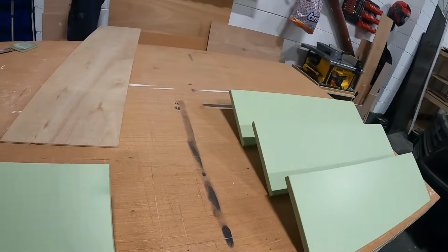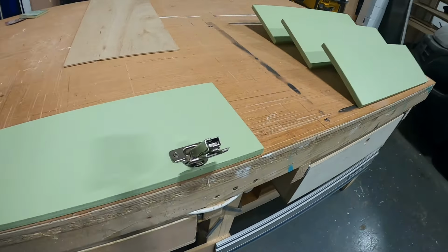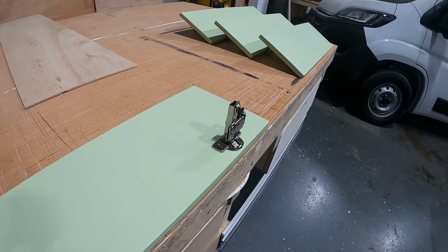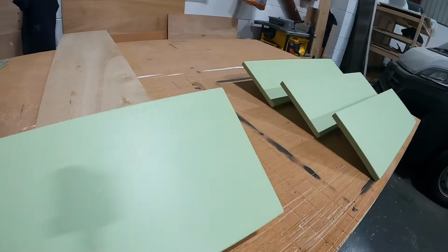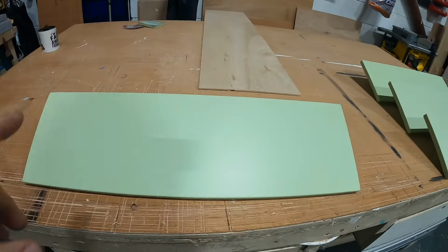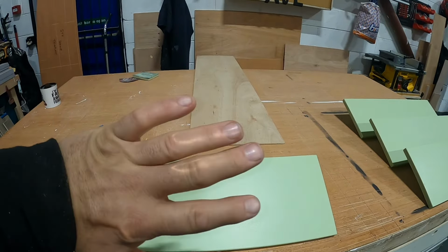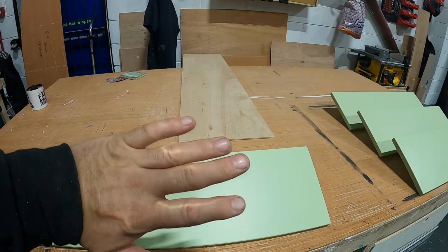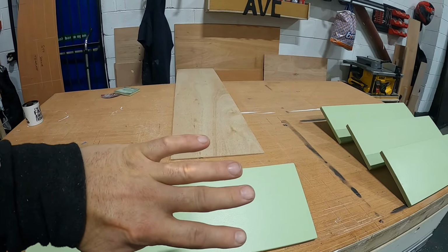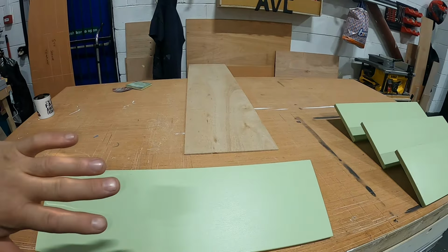Like I said, they're all soft close, so you can test it before you fit it on. What I like about these hinges is the adjustability. That door's on your carcass, and the adjustability on those hinges can make it go like this and like that, and also that way and that way.